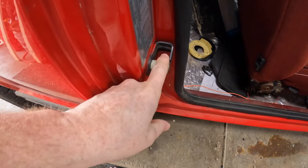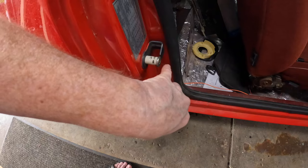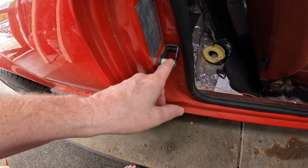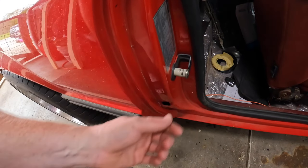I bought the bushings for that size a while ago. After I turned the camera off, when we started putting those on, we noticed something we may need to fix before putting the fenders on. We were putting these little plastic sleeves on the strikers — people buy new strikers thinking they're worn out, but it's just the plastic sleeves. Just go to a parts store, buy a package for like five bucks, and slip them on.